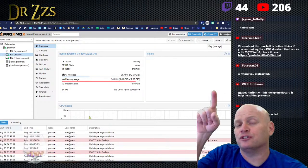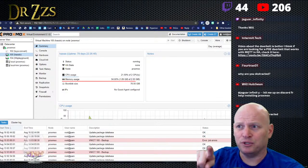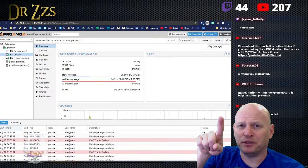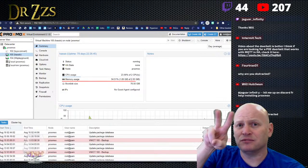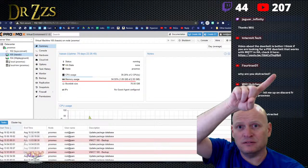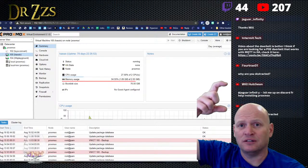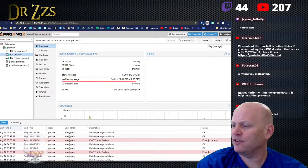If you want 4K on your screen, what you should do is get a 4K splitter. So you put your HDMI input in to the splitter, you get 4K split, one 4K goes to your TV, so you can watch in 4K. The other one will go to a different HDMI capture card. And I have a couple of them.